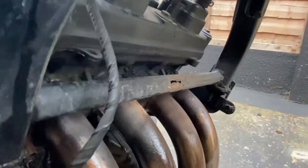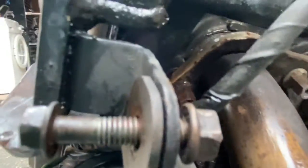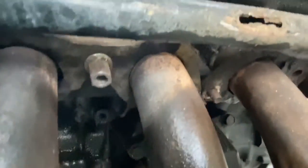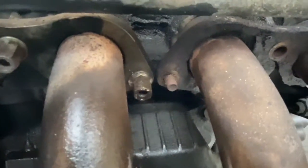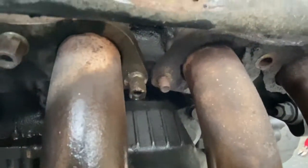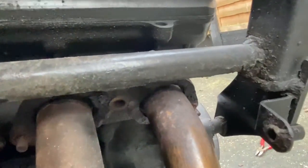I needed to move the radiator because my exhaust stud nuts are very corroded. I've got two out already but there are more that are very very tight. I've sprayed them up and I'm trying to get a blowtorch in there to heat them up — getting the radiator out of the way gives better access. I suggest just spraying them up, letting it soak overnight and attempting it, but don't hang off them because if you snap these studs off in the engine you're in a whole world of pain.